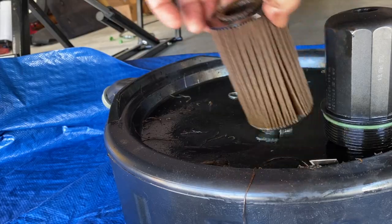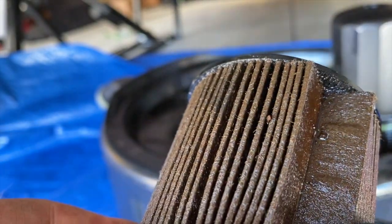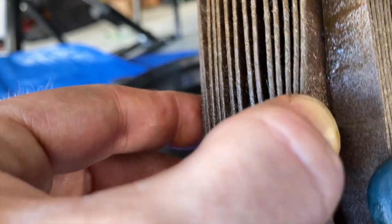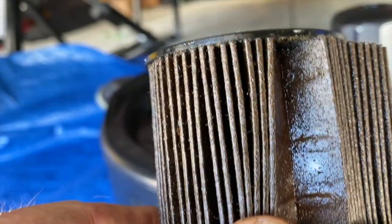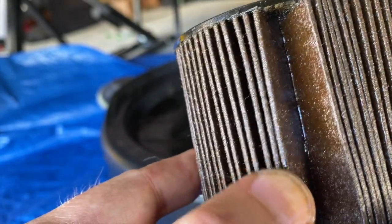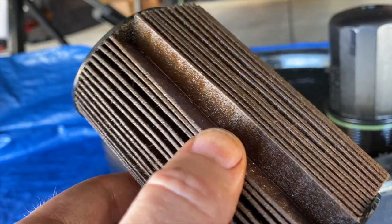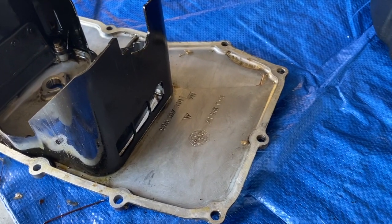You can see them in relation to my hand - they're not tiny, so very worrisome. Every time I take my oil filters off I always want to inspect them by pulling them open accordion style and looking for any sort of debris getting trapped in here. I actually do have quite a bit of metal shavings in mine. In this one there is a good-sized shaving right there, and in some others I have smaller flecks of metal and some plastic pieces. Hopefully yours looks more clean - what does that mean for me? I'm not sure yet, going to keep running the engine and check the filter next time after a couple thousand miles.